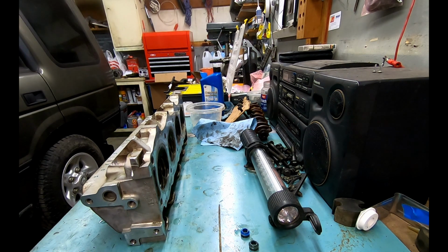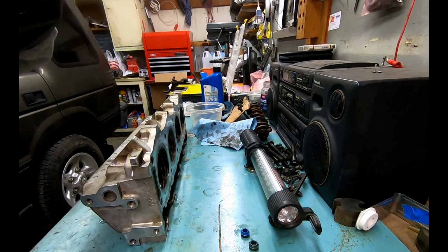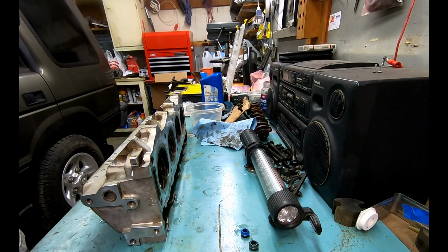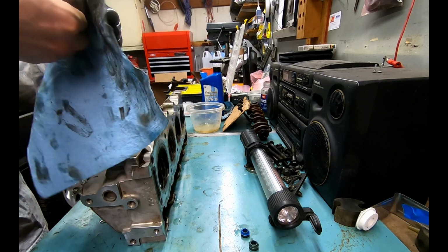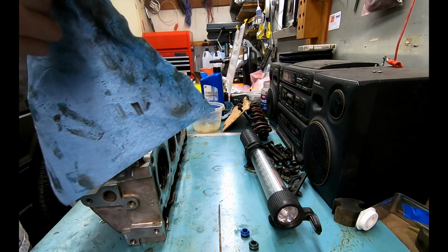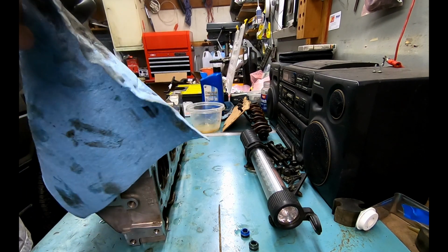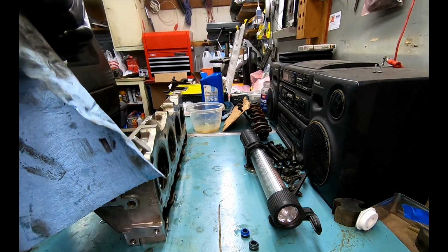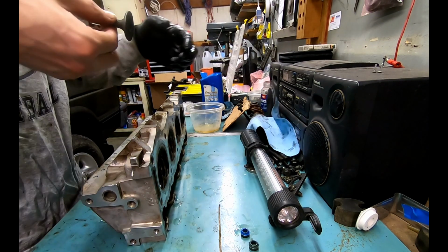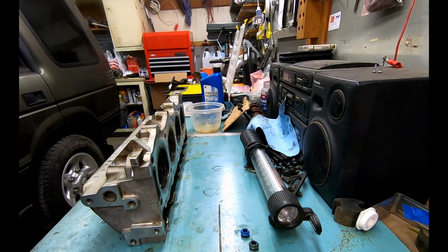But yeah, so that is lapping valves, the quick and easy way. You definitely play it safe rather than sorry, and then do visual inspections, because if the color isn't changing, if the texture isn't changing, then you can probably do a little bit more. But if you're just going to town and you pull the thing off and it's all polished and shiny, with this big shiny path, you get to the point where you're seating it too far down. You want it to be consistent across all your cylinders. You don't want it to vary too much. So there we go. And that's it for that one.